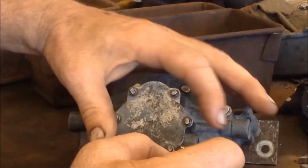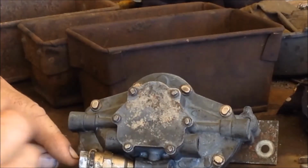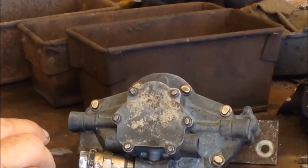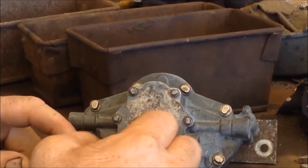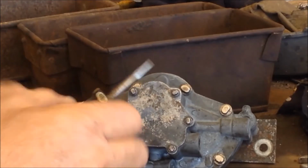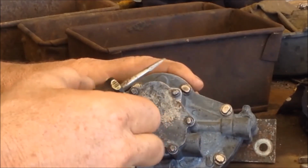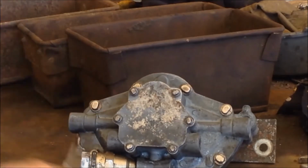Okay, and here, it's got run written on there, you probably can't read that. And there's run on this side as well. And this is the exhaust to let the air out. Now what I found was, when I cleaned it all out and put it all back together again, clean this valve here out, and this is like a non-return valve, check valve, but this is the exhaust. The air would run continuously out the exhaust. Now I would expect, but I don't know, that there'd be a pulse with each transition, if that makes any sense. So if it starts over here, when it comes around, this exhaust will be open to let the air that was pushed this way back around to this way, so the air can come out. And then when it goes back the other way, it'll swing to the opposite side, and it'll push the exhaust, would work empty out this side, not continuously.